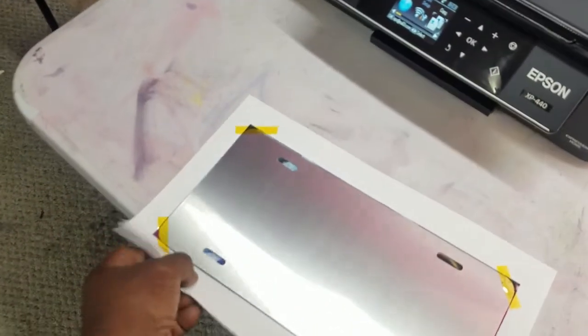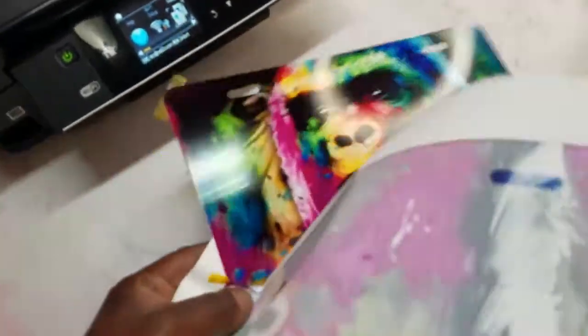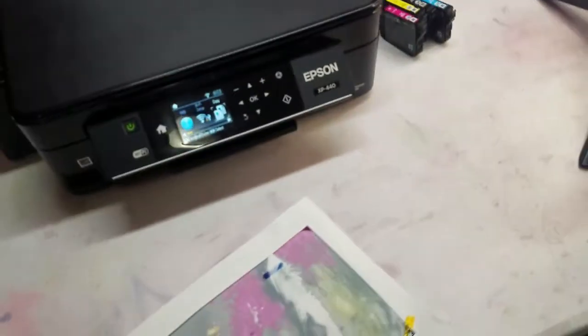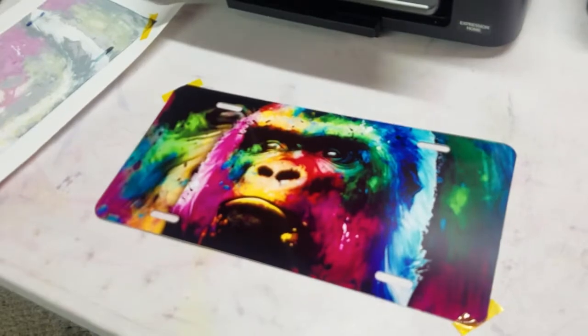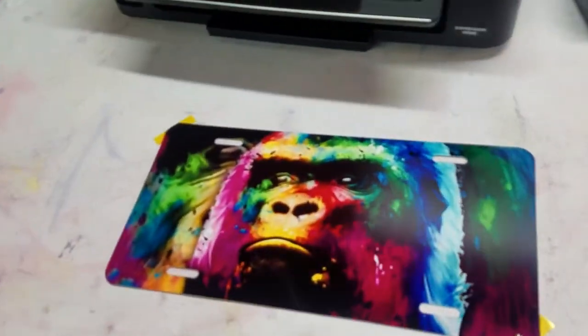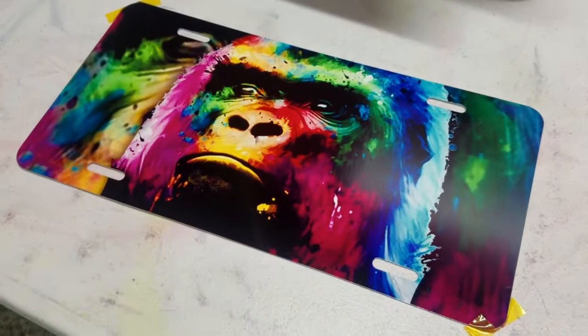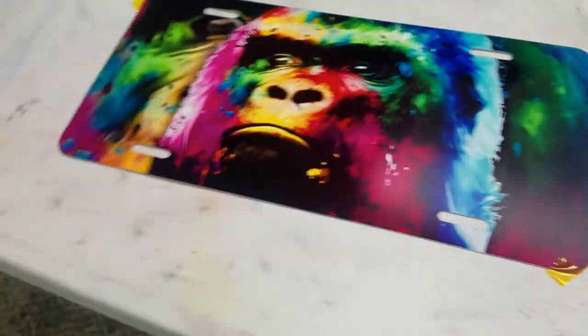Now these was pressed with the Dynamite Gorilla Ink, and I pressed this at set up for Celsius, so it's 200 degrees Celsius, and I think I do 60 seconds on it. So yeah, 60 seconds. Let me get this light out of here so y'all can see that. And this is printed at just base Adobe RGB driver on your Epson driver. So it's just basically using the base RGB, and yeah, it looks really decent, man, with that ink. Like I said, base RGB. I think the gamma set at 2.2. Yeah, 2.2.